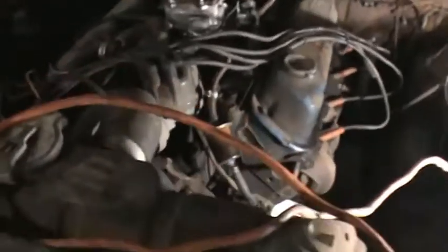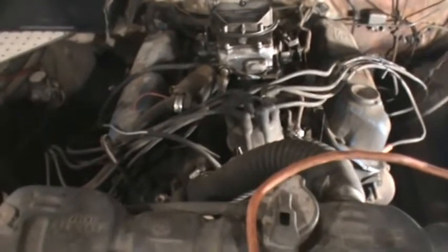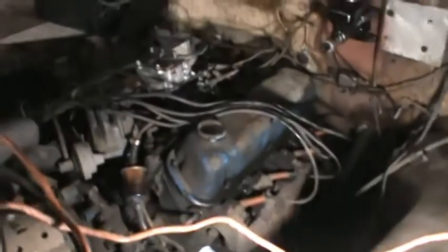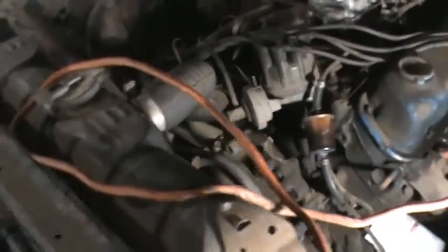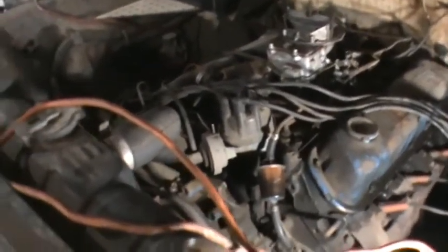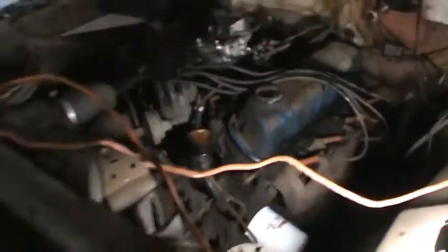The motor's still kind of missing. I'm sure a lot of that's in that carburetor. The timing's right, as far as I know. It's really kind of hard to tell with the exhaust leaks and everything else. I know I don't have the vacuum right on there. It's supposed to have a thermostat temperature switch that keeps it from overheating. But anyway, I'll know more when I get the mufflers on it,